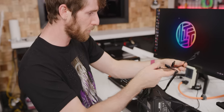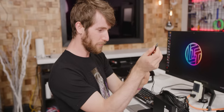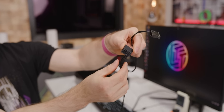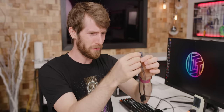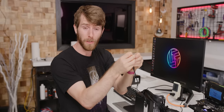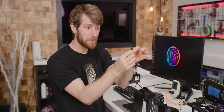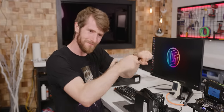The other notable omission is: where are all the SATA and Molex connectors? Well, we do have one lead that's got a SATA and then two Molexes. But if you look, the 3.3-volt and five-volt conductors aren't there — so they're just 12-volt, which means whatever you're powering with these would have to not require any five-volt power. So for example, if you had a fan controller or a front panel thing on your case that used a SATA connector but only needed 12-volt power, you could use it. It's mechanically compatible, but not necessarily electrically compatible with every device that it would plug into. There's going to be some headache and heartache in this transition.